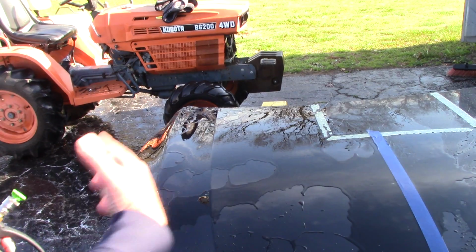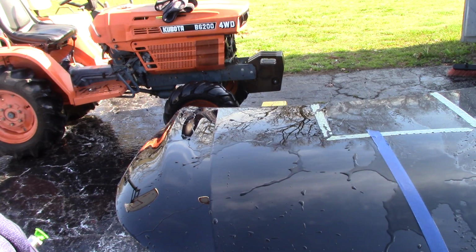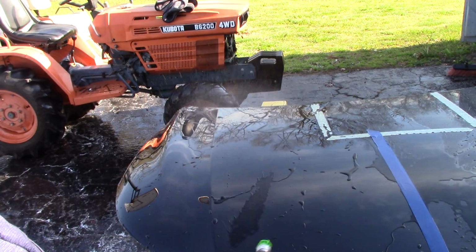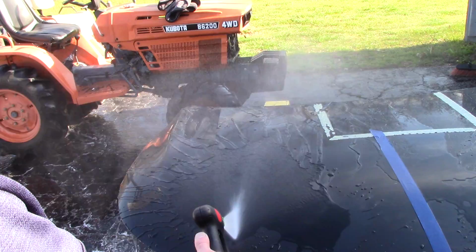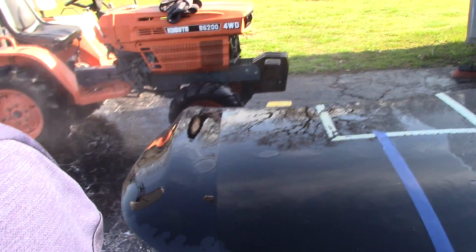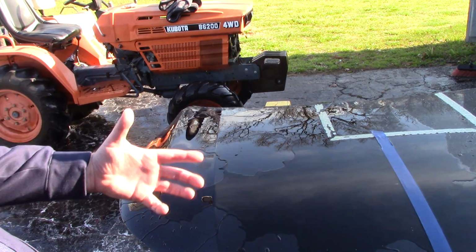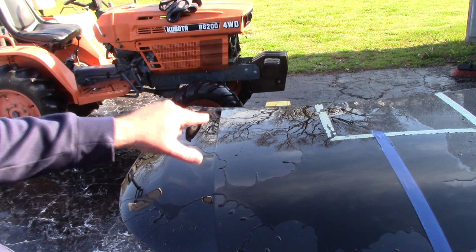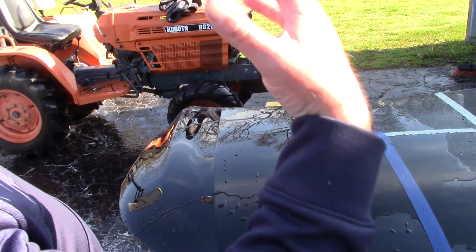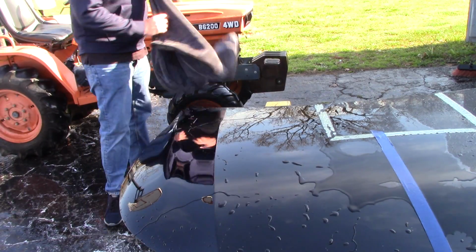Now what's very interesting is the more I keep rinsing off this panel, you've got to remember I'm using tap water. It's not DI water. There's going to be residue from the high TDS levels in my water as well. But the water right now, here watch, I'll flood the panel. When I flood the panel, it still wants to repel the water like a true silica product. But you'll notice it's kind of decreased a little bit, right? Not as quick as it was because of high TDS levels in water, when you're not using a DI machine or an RO machine or a CR Spotless, let's just remove some of the minerals that might still be on the paint.